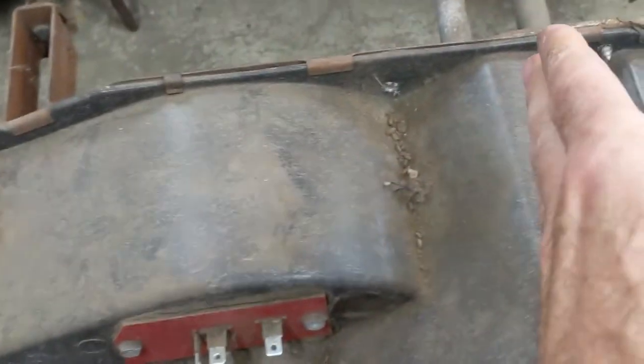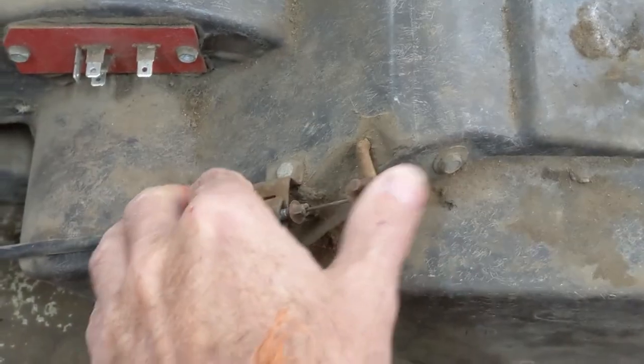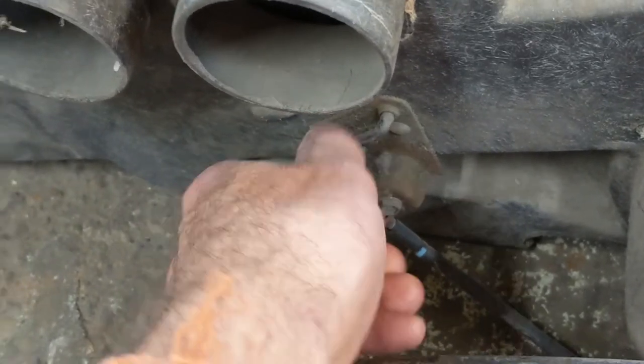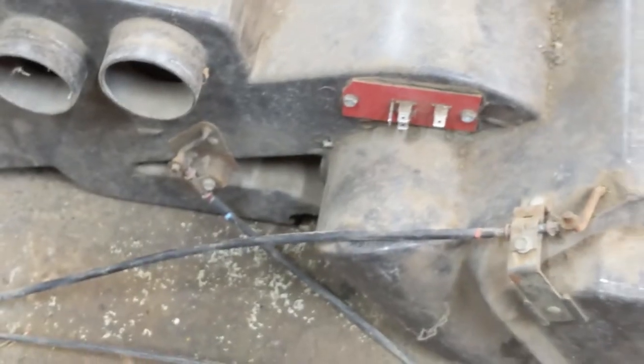And then the heater core is here and it's on a bit of an angle. So this hole here, the fan will pull cool air in. And if you want heat, you'll have your blend door adjusted so it's on the heat, whichever way that is. I'm not 100% sure on this one. And if you need defrost, this blend door or the defrost door right here, you can open and close it, and it'll redirect the warm air because it's on this side of the heater core now, all this stuff is. That puts the warm air through.